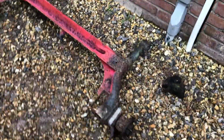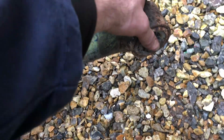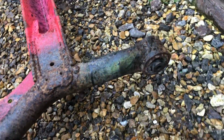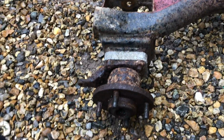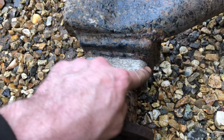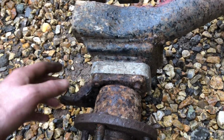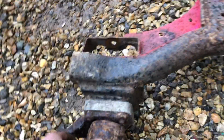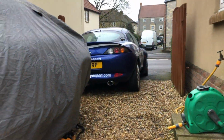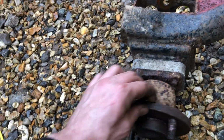Finally, something I've wanted to do for a long time, as you're aware. So rear beam's off. The rear bushes are absolutely shot, so they definitely need to be replaced anyway. This all seems not too bad. Shot blasted and powder coated, look good. I've just got to take off these 20mm rear spacers, I think they're 20mm. I'll look to fit some 30mm press car spacers, the same as they did on the 5 press cars when they released the Ford Racing Puma. Usually they got 20mm, but as I said, 30mm just improves the stance slightly.